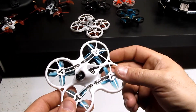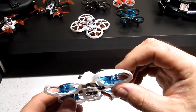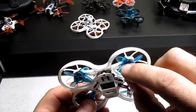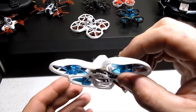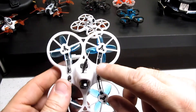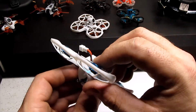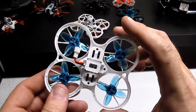It would fail safe out. I was poking around — it could have been one of two things. Normally when I fly in my basement, when I hit a corner or land somewhere that hasn't been touched in a while, I get a lot of junk, cobwebs, and hair lodged around the motors. I noticed there was an abundance of that in this motor. I pulled everything apart, checked all the connections — it could have been a connection at the board, but it felt solid. Anything touching the coils could short it out or cause it not to fire up.